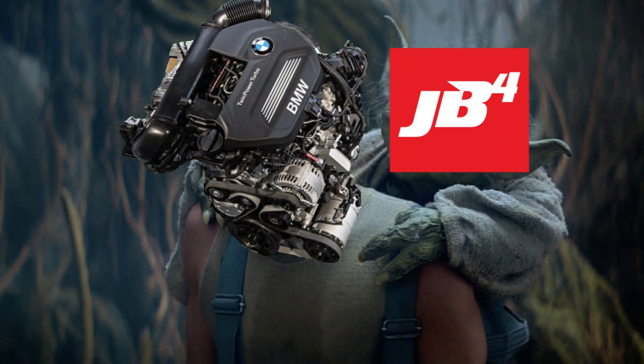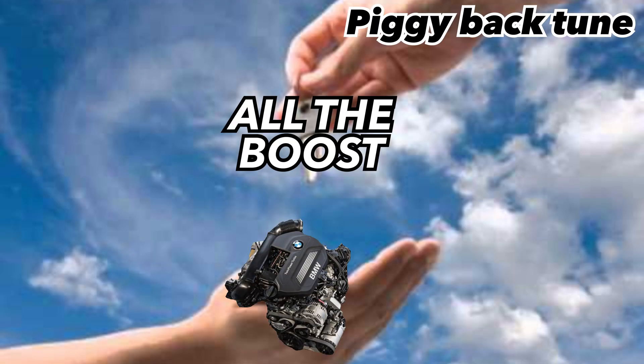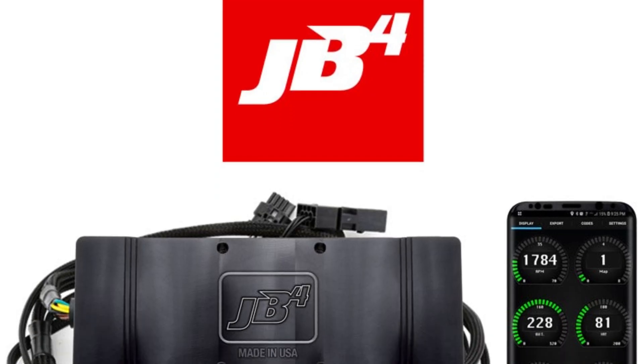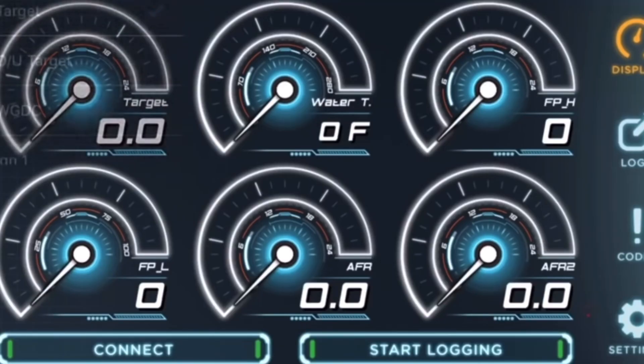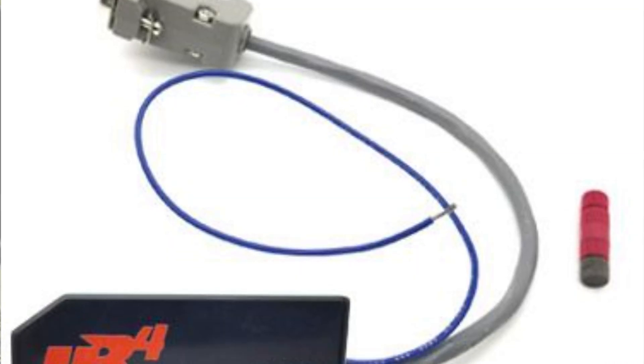The first thing on my list is going to be a tune — that's going to give you your most bang for your buck. The first tunes I'm going to talk about are piggyback tunes. Basically what a piggyback tune does is tell the car you're making five pounds of boost, but in reality you're making like 10 pounds of boost. It doesn't change your timing or anything. The first tune I'm going to talk about is JB4 — it's a really good piggyback tune. You can go back and forth through your tunes with your phone using a Bluetooth connect kit, and you can have a list of tunes that you want.